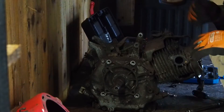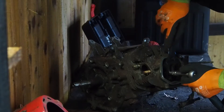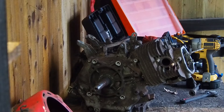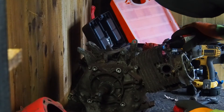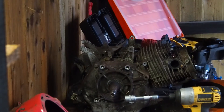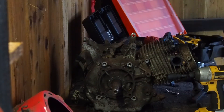It's always a lot easier taking things off than putting them back on, believe me. There's no real pattern to it — I just go with whatever's easiest for me in the moment. Taking the valves off is nice and calm as well; it's so much more of a pain trying to adjust them putting them back on. In this bit I had an absolute nightmare trying to get these bolts out because they're all rusted in there, and at the time I just had a weak little impact socket. I got the rust remover on trying to soak it out but it did not go well. This is the reason why I've not fixed it yet — I knew I couldn't get the bolts out, but as you'll see in part two of this video I have the right tools now.